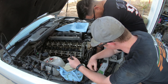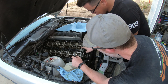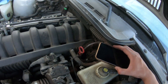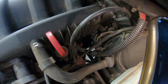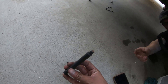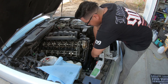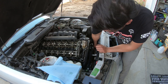George is going to crank the engine with a 22 millimeter and we are going to get it to top dead center. There's a couple ways to tell - there's some splines down here on other M52s, or you wait till the cams get to 45 degree angles of each other, and those should be flat in the back. There are plenty of videos to show you exactly how to get your motor to top dead center. On the driver's side manifold, there's a little blue plug - you need to pull that out and stick this locking pin through it. It goes through the flywheel, which has one hole, and it locks the car in top dead center so nothing shifts and nothing moves. The motor is now locked.